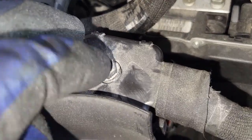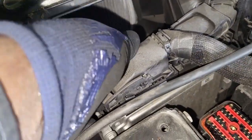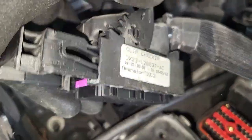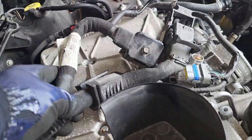At the top, take out the wiring harness — it's 8mm bolts, take those two 8mm bolts out of the way. Then disconnect the wiring harness: disconnect only one section and leave the other. Pull that section out, and you should have two sections sitting on top of the engine.